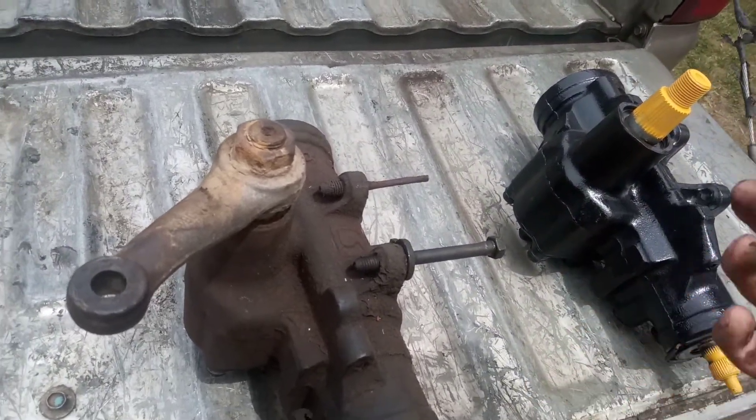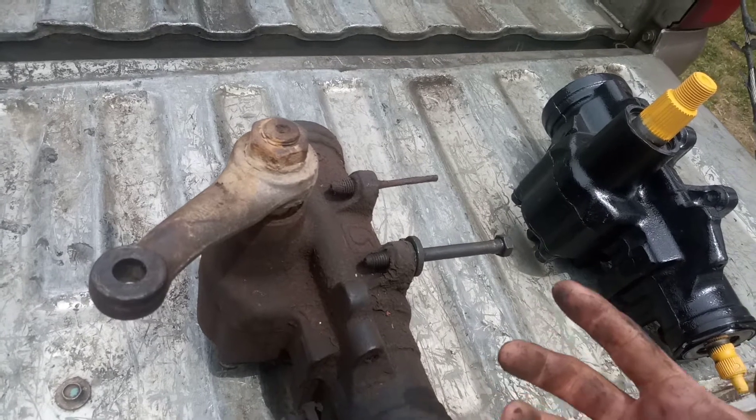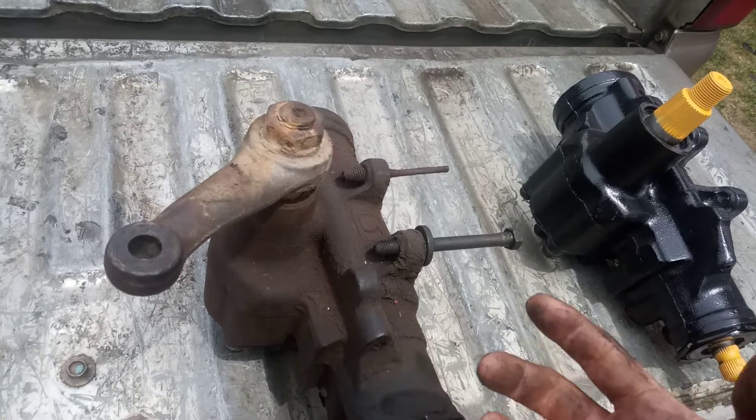The reason it can't have water in it is that these gearboxes on the inside — picture your engine cylinder wall. As soon as you get rust in there, it will flash rust on the inside, which creates pitting, and then your seals won't seal.